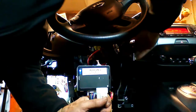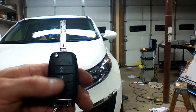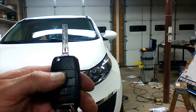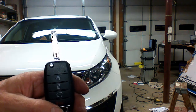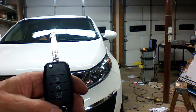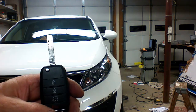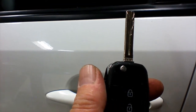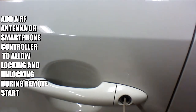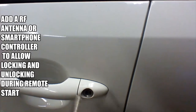We're going to shut the key off and remove it from the ignition. We're going to activate remote starting by locking the doors three times — this will trigger remote starting. Note: we have not yet made our parking light connection. The OEM remote does not function while the engine is running on this vehicle. To enter the vehicle while it's running in remote start mode, you need to place the key in the door lock and turn it the old-fashioned way. If you turn it twice, you'll unlock all of the doors.